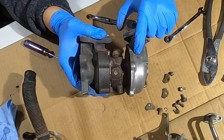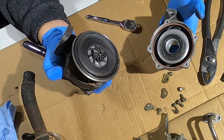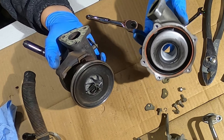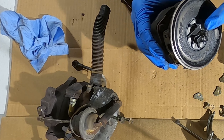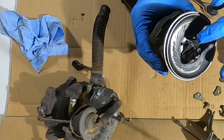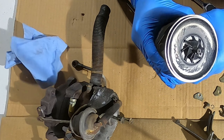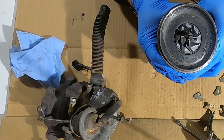The compressor half is supposed to just separate from the cartridge — and it comes right off, easy. This actually weighs almost nothing; it's aluminum while the exhaust side is cast iron. Inside here is the compressor wheel — air spins this really fast, gets pushed through a smaller outlet, and sent into the engine. Mine's a little goopy in here — that looks like oil getting into the intake, gumming up the turbo.